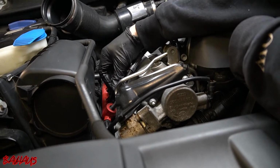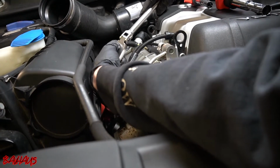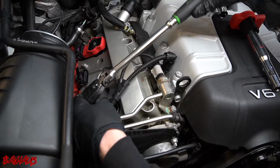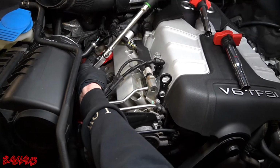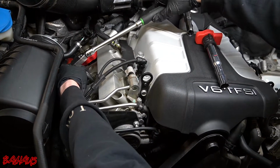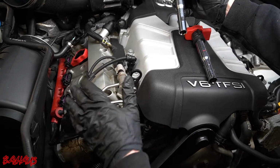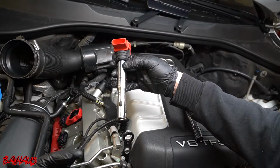And once I get it tight, I'm just gonna give it probably an extra quarter turn on with my ratchet. Right there, it's nice and tight. Ratchet kind of binds up, so that's when I know to stop. The torque spec probably is a little bit further beyond that, but you don't really want to screw around without a nice torque wrench torquing spark plugs, because you run the risk of stripping a cylinder head, which you do not want to do. So that's safe and more than fine. Most people run around in cars with under torqued spark plugs actually.